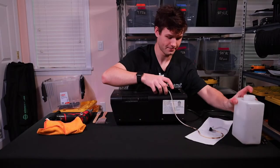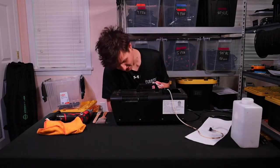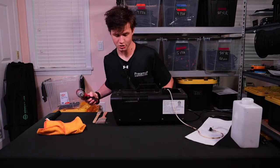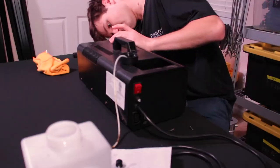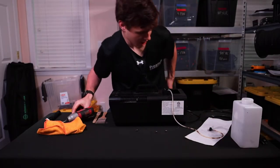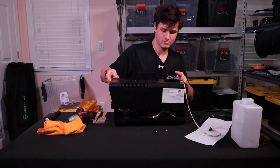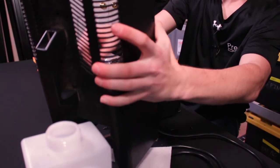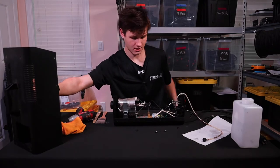What we're really going to be looking at is the inside of the fogger, making sure everything's clean, because it gets pretty hot in there and you don't want anything catching on fire. There are a whole bunch of screws — I'll speed this up. Now that all the screws are taken out, the top should lift right off. Keep in mind it's still attached to the hose, so put this cover over here.